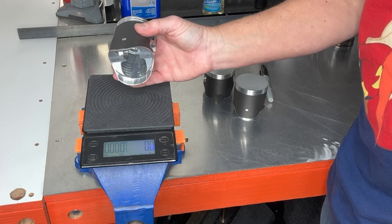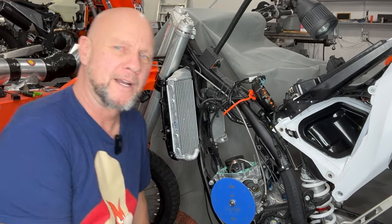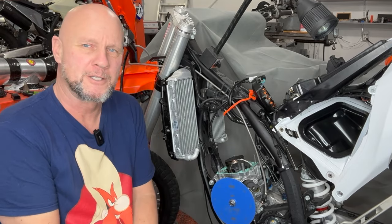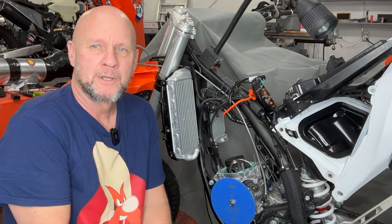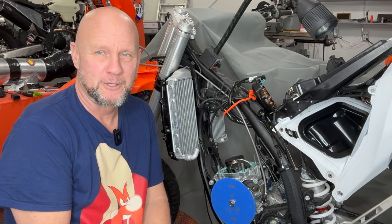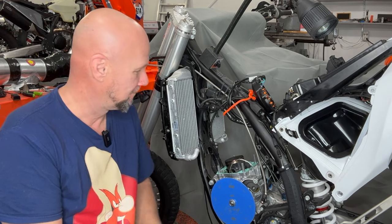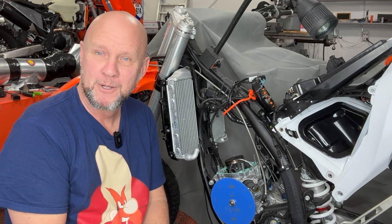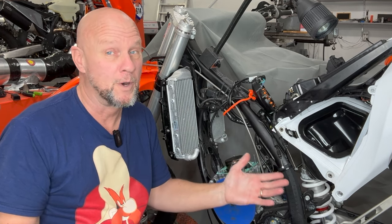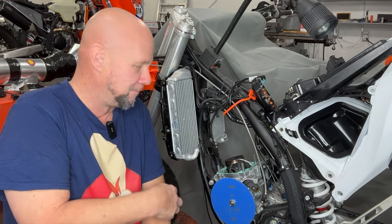This is a 250 cast piston out of the same new KTM bike — 225.3 grams. That's the difference of about an ounce. So me calling that guy a dumbass — there are two funny things about that. One, he was more concerned about a small factor than the big picture: your engine scattering and no parts available. But showing you those piston weights, the other funny aspect is: for those of you worried about that kind of stuff — the crankshaft in both the 250 and the 300 are the same, and the counterbalancer in both bikes are the same. So which piston weight is it set for? One of y'all is losing. That's how funny that is.